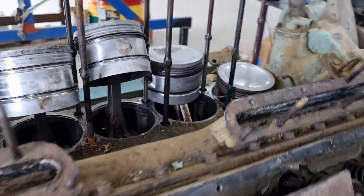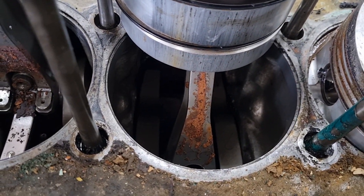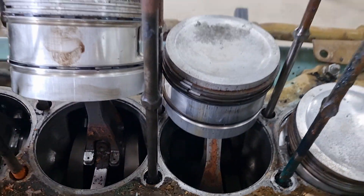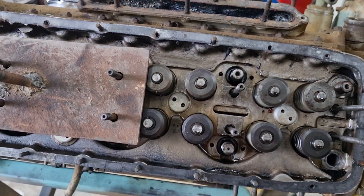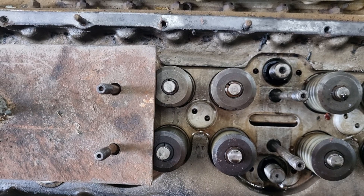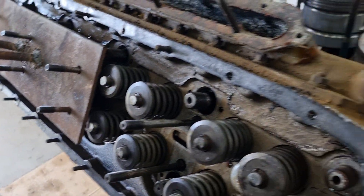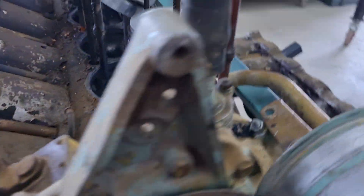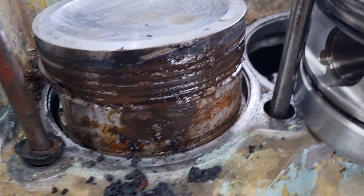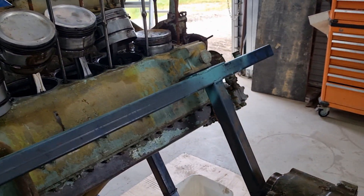There is rust inside the engine. That's not good, but it should be repairable. When we pull this side off it's going to be interesting, because we know for a fact that this piston is not playing the game. We'll have to have a look at that one — the control rings on this one are seized. They're not popped out like they should be.